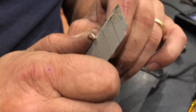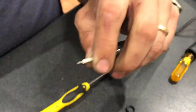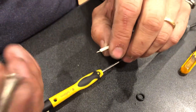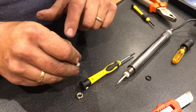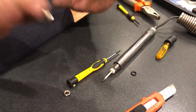So there's the inner core — that's the bit that I want to solder up to the end here. What had happened was in the process of me untwisting this to get it off the bull bar, somehow the solder broke and popped out. But as I said, to the life of me I couldn't work out how to pull it apart — and that's how you do it. I'll unsolder this, put it back, and show you that in a sec. So I'll just pause the video now.